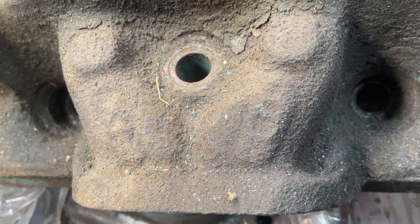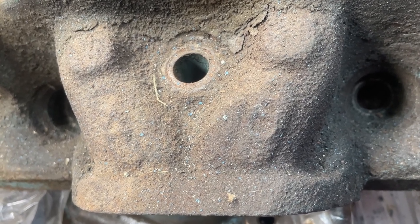Now, this does leave bare metal, so we'll address that in a second. We have this thing stripped of rust and stripped of paint, and we're ready to paint it now. With Pontiac heads, you want to make sure you're using some VHT header manifold paint. This is because the exhaust ports on the Pontiacs are part of the head. You want to make sure you have good high-temp paint on those to avoid issues with paint burning off. With that completed and primed, we can go ahead and throw our paint on there.